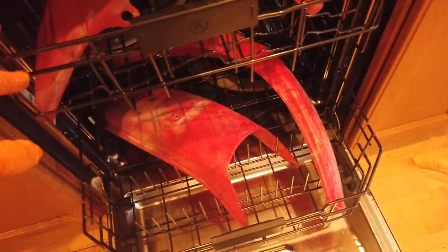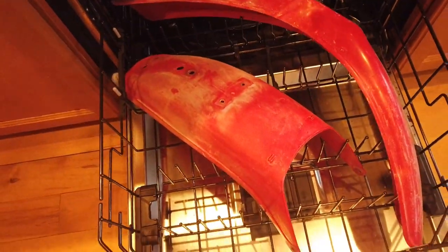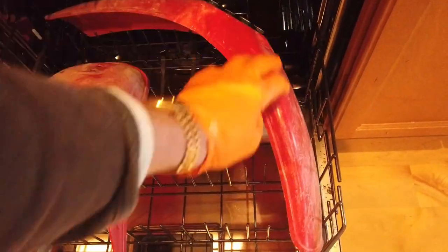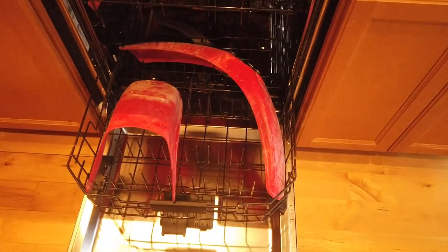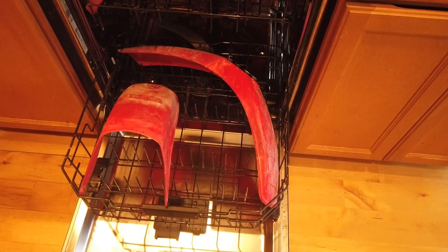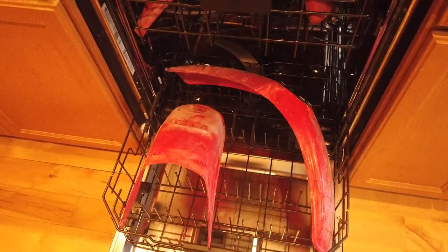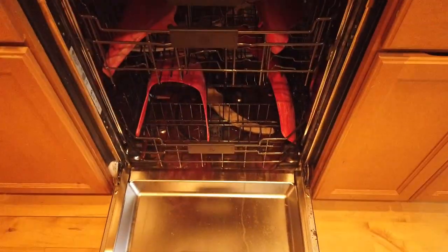These are the plastic parts — the original parts that came off. I've started to scuff them up with sandpaper. If I take the mud guard which I haven't sanded underneath, you can see it's still full of paint. So effectively what I'm going to do is just clean this in the dishwasher to get all the chemical crap off it — without heat obviously — and then put down the adhesion promoter and then the enamel primer on these and see how that comes up. Let's put them in and wash them.